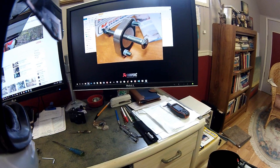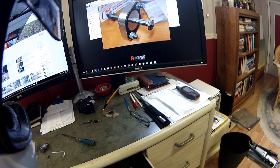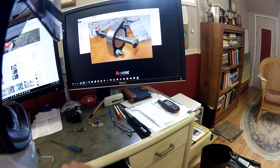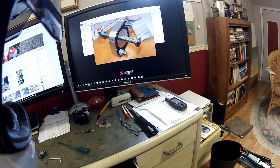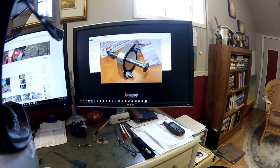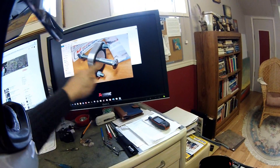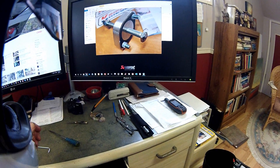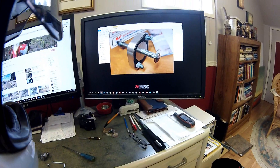Then you start the engine. I started the engine and went for a ride and it was definitely too tight — I heard a whirring sound that stopped when I throttled it just a tad, which is definitely too much pressure on the cam chain. So I loosened the locking bolt, backed off the tension until I could hear the cam chain rattle a bit, then increased the tension just enough for the rattle to go away, locked it down, and that's been fine.